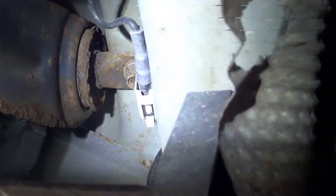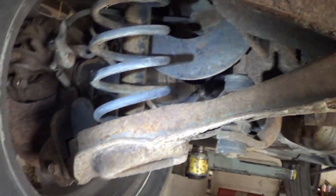So here's our sensor, and the wire goes up around here — it looks like it unplugs right there. We got no reading on either side. There's our other sensor; wire looks intact. Going to the other side. By the way, this car is extremely rusty — this must be a northern car. They've had some brake lines repaired here; they obviously rusted through and have been replaced.